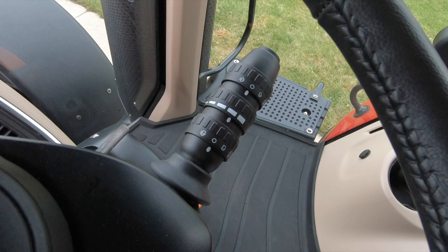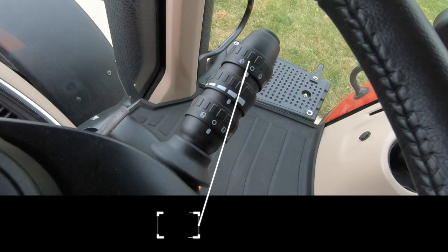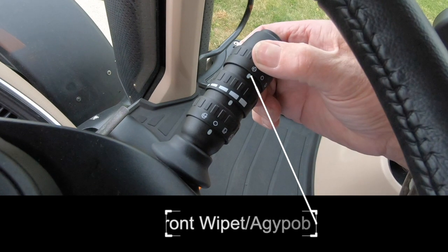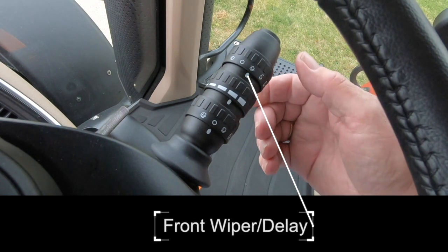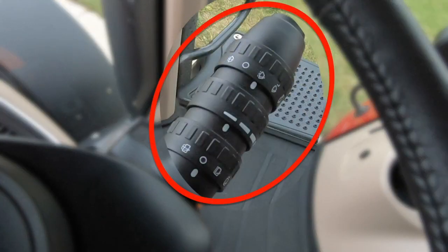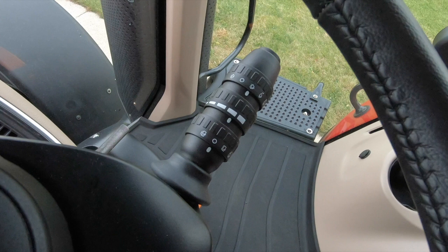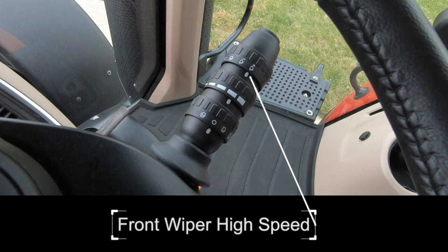The layout of the stalk is as follows. The windshield wiper controls all three wiper blades on three rings on the handle. Ring 1 is the furthest out on the lever, controls the front wiper, and has five positions or detents. Positions include: front wiper and wash (momentary, turns on wiper and washer pump), front wiper off, and front and rear wipers on intermittently. Ring 2 controls delay: the further forward the ring is turned, the shorter the delay on wiper activation, with five delay positions. Additional positions are front wiper low speed and front wiper high speed.